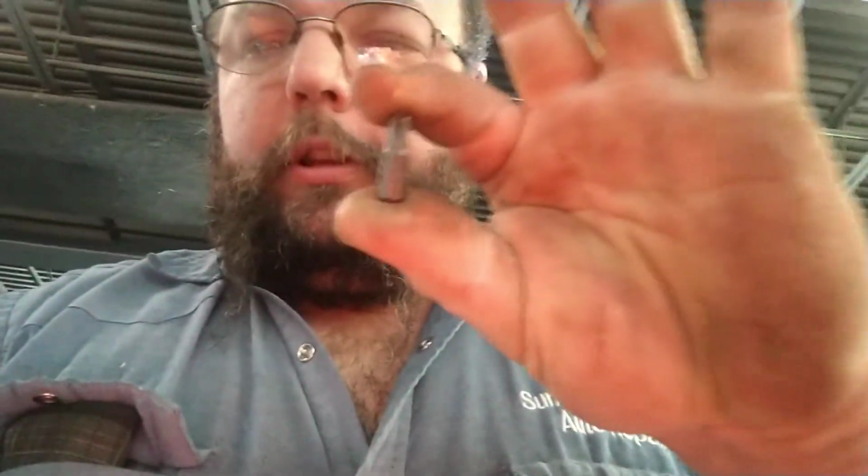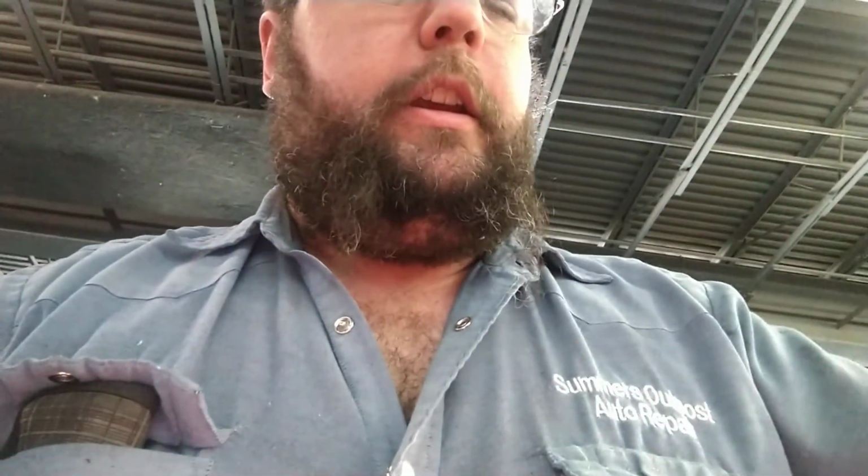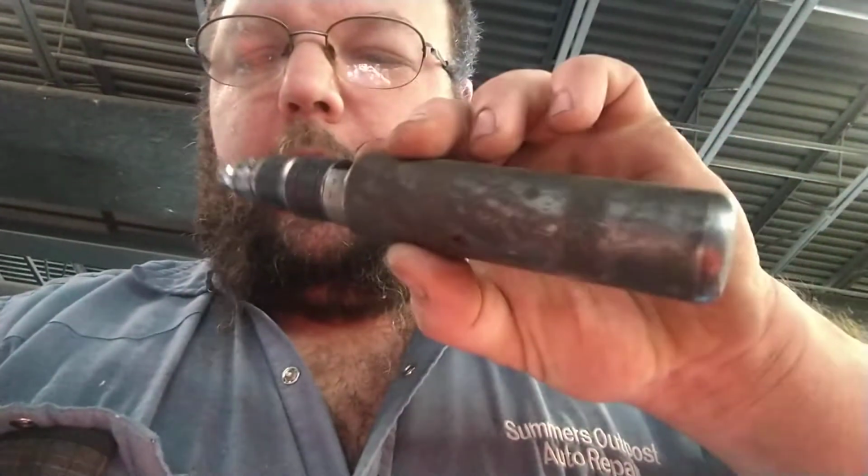And I usually do it while the brakes are still on here, because it makes it harder for it to rotate, but still. I take just a common old screwdriver bit, usually a number 3 because it's bigger, and a 1/4-inch socket on a 1/2-inch adapter on an impact driver.